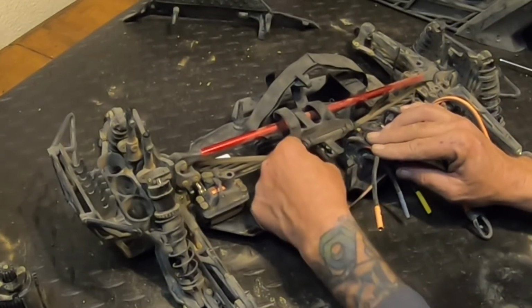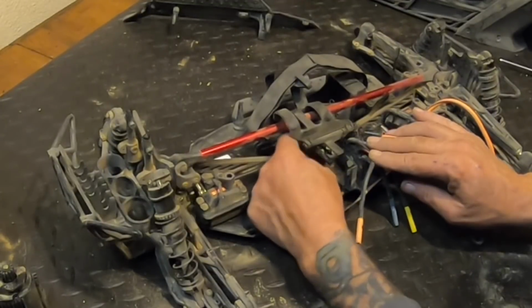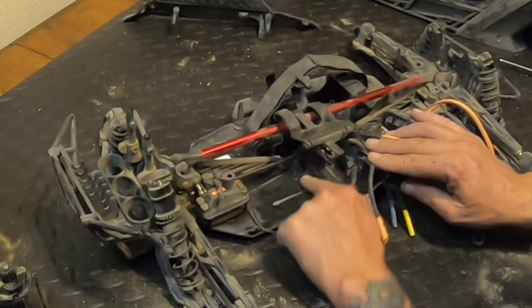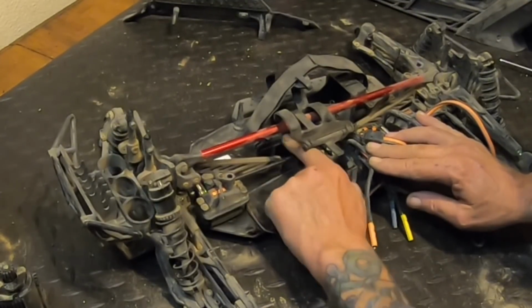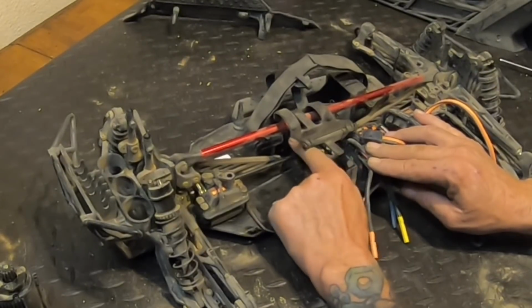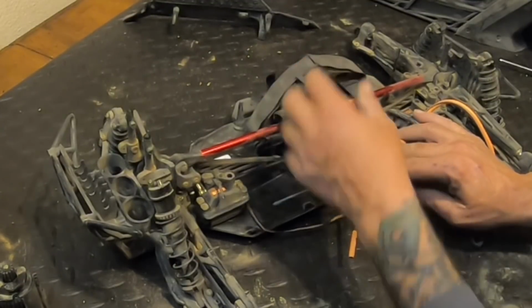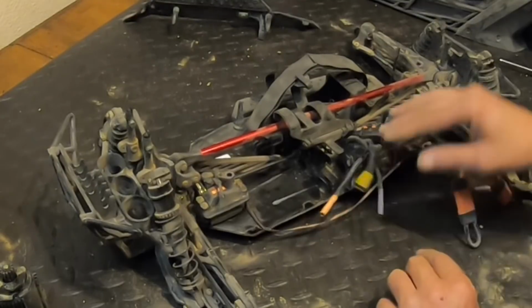I do like, feels really smooth. So the bearings, no play forward or back. This drive shaft is bent. The front one is a little bent as well, and I relate that to the screws to the center diff mount holder deal. The 3 screws falling out, that's pretty much what bent that.